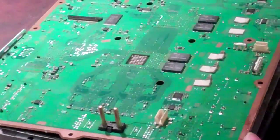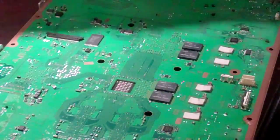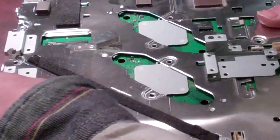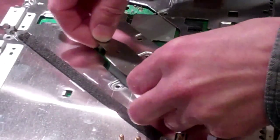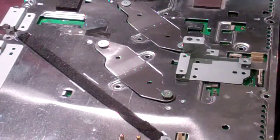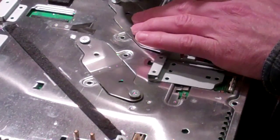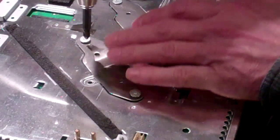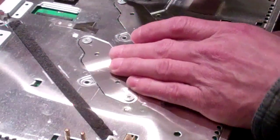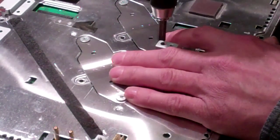Once that's done, put your board back into the rack assembly. Put the fan assembly down with the two notches to your right and drop that into place. Put the clamps on. Start all the screws first so that you get a good placement. Once you've got them all started, you can go ahead and tighten them down to one side then come back from the other side.